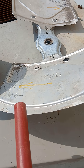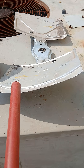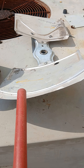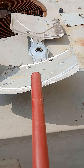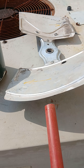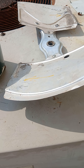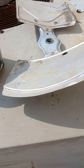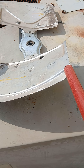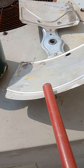Looking at the side angle of the fan motor, we can see a low side and a high side. Keep in mind it needs to turn in the direction of the low side to pull the air up. For comparison, if it were a ceiling fan and you wanted to push air down, you would rotate it in the opposite direction toward the high side.